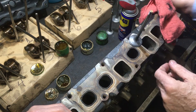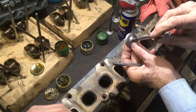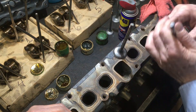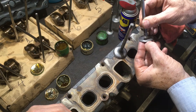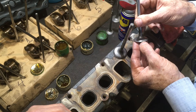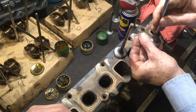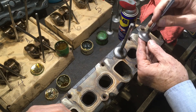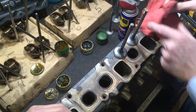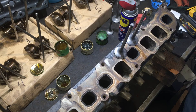This is what we started with — you can see the imperfections around that surface. They aren't really large, but I can feel them with my fingernail. And now we've got it down to where there are just very few pit marks at all. A few more minutes of this and I think we're going to have a lapped valve. Then we'll put everything back together and test them for leaks. It wasn't real bad when we started, but to save money and not put a lot of effort into an engine that may not be any good, we're cutting corners here.